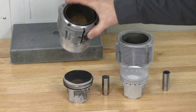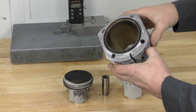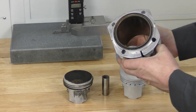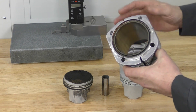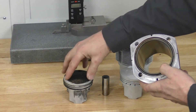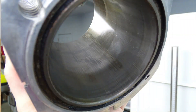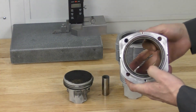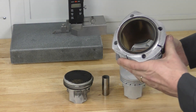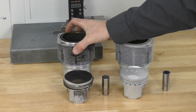The other visual inspection we want to make is in our barrels. On a barrel cylinder with a cast iron liner, it is possible to perform a honing operation if the barrel is still serviceable. This barrel came with that piston, and down inside we do have some damage that I can feel with my fingers. We will measure the barrel to determine the extent of the damage and possibly use an oversized piston.